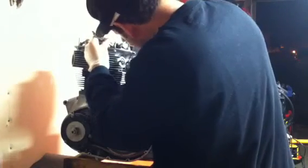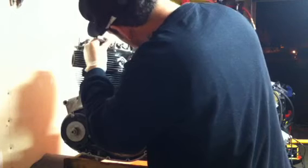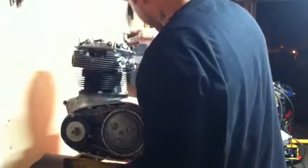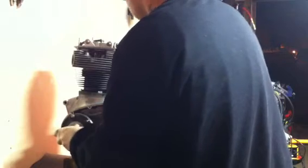Get the feeler gauge in here cleanly without rubbing on the shoulder or any of these studs. There we go. Alright, we're in it. We'll stay right there for right now. Adjust these like 2 or 3 times, because you always want to go back and double check them after you lock them down. You do them both, turn it through everything, then you do it. You end up doing it like 2 or 3 times before it's perfect. And go back and just check them all one last time, just to be for sure.